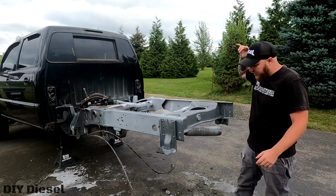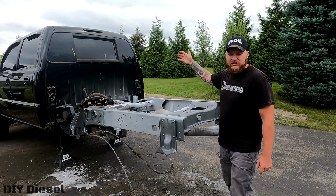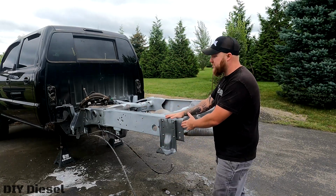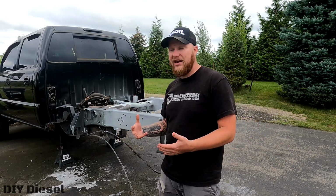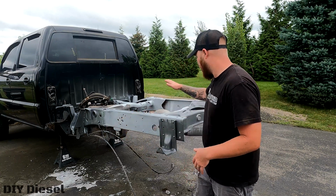And then we're gonna create a completely whole different video on the axle. So stay tuned for that as well. I'm not gonna galvanize coat the axle. And the reason why I'm not doing that is because I want to see what this protection versus the axle's protection. Honestly, the axle's pretty easy to take out to where if my paint failed or my primer failed on it, I'd be all right to take that out, take it to a sandblaster, have them re-sandblast it and do it the right way with the galvanized.